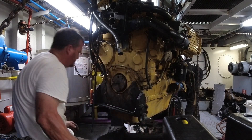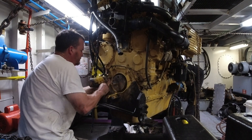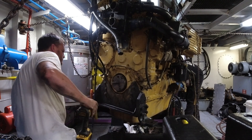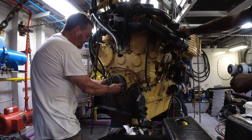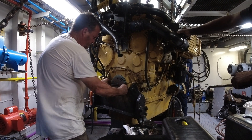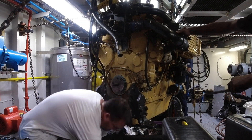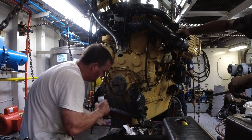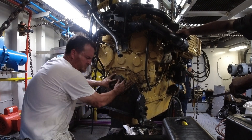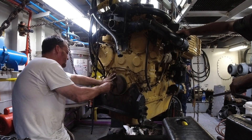So mainly it's just the installation. You can see me bolting up the adapter plate there to the crankshaft — that's really just a guide to center the seal for you. Put the seal on there, then we put on the pusher plate with the jack nut, or the pusher nut, however you want to call it. This is an installer you can get from Caterpillar, aftermarket like what you see, and I'm sure there's more on Amazon — I may throw down a link to help you guys find one.